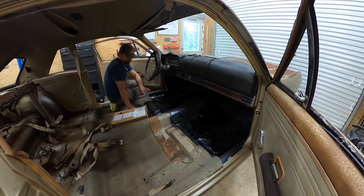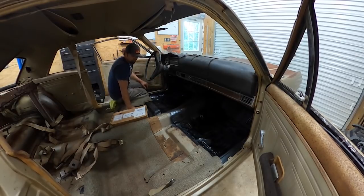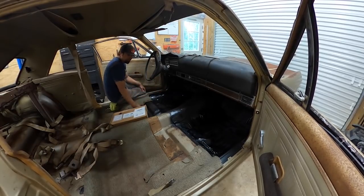What I did was I just cut them in and kind of piecemeal them, and then tacked them in place. I painted underneath, painted the best I could on the floor pan and the frame, because obviously I can see the top of the frame rail now, because that's how bad these were. Then I cut them up and pieced them in, got my torches out, took the ball peen hammer, heated them up and banged them into place. And they worked pretty good.